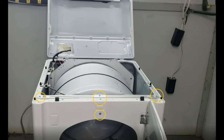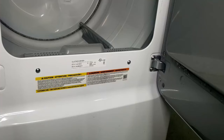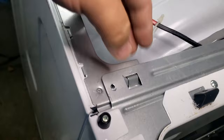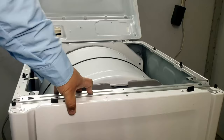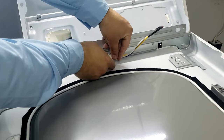To get the door off the unit, there are four screws on the top of the dryer lid, two on the dryer lint filter, and one where the door switch is — all seven screws need to be removed. There are also two metal tabs that help keep the door on, and with all screws removed you can depress the tab to take the door off. With the door slightly removed, you can attempt to remove the door switch wire harness. I had a difficult time with this, so I took the door off by pulling it out and lifting up slowly so as not to damage the wiring, then placed the door on top of the dryer to remove the harness more easily.